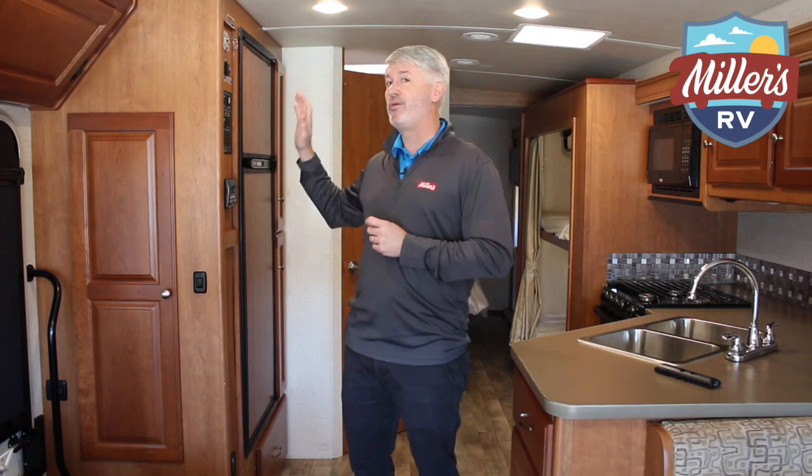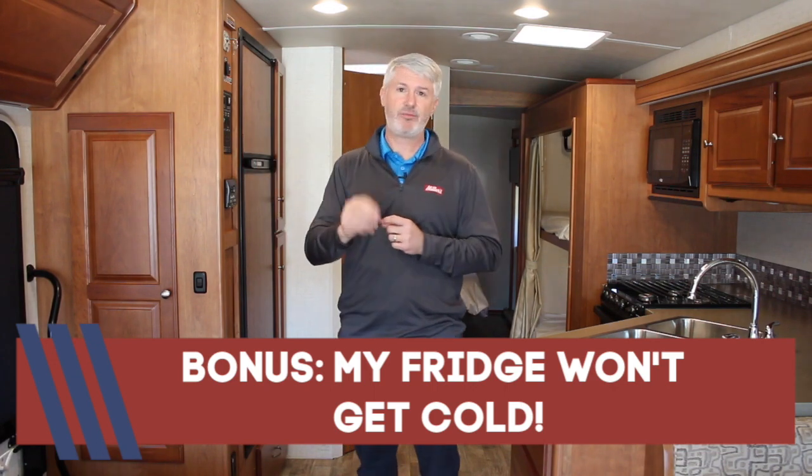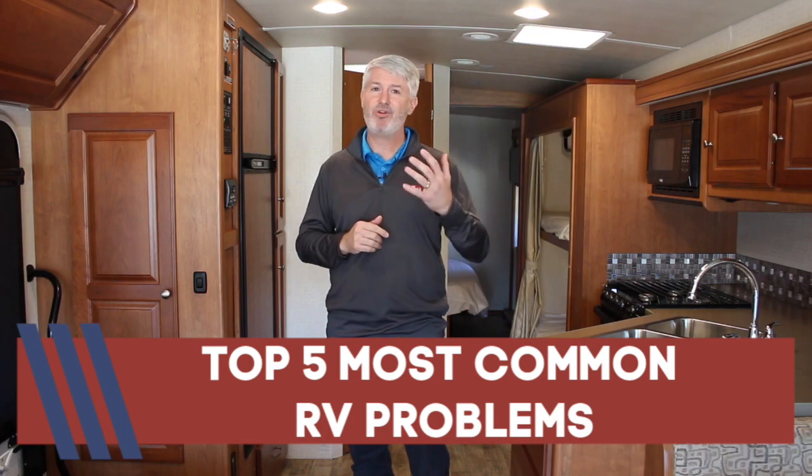As a bonus: if your refrigerator is not cold. Most RVs come with a gas absorption refrigerator — a gas absorption refrigerator takes about six to eight hours to get cold. So if you've turned your fridge on and it's only been two hours and it's not cold yet, don't worry. Give it six to eight hours and it should be cold — you'll feel it get cold first in the freezer, then the fridge. If you smell a funny ammonia smell or see a yellow powder outside the RV, that's trouble — it means you've got a cooling unit leak and will need repair work. This is Jeff Hilliard at Miller's RV with our top five most common questions from new RVers and RV renters.